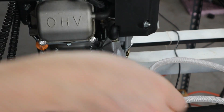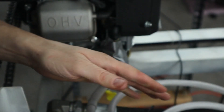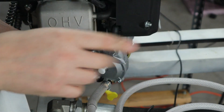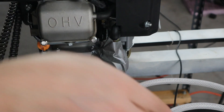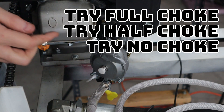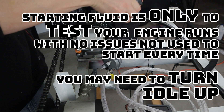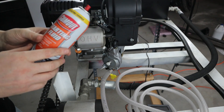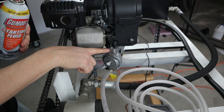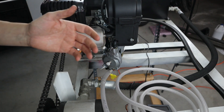In order to start it, I'm going to burp the diaphragm — when you burp the diaphragm, you're letting some propane through, so long as you have your regulator in place properly. To start the engine, push the regulator in and switch it all the way to high, making sure there is no flow — you have to listen and confirm there's zero gas flow at this point. Once you're ready to start, with it on high, burp the regulator for a couple of seconds and give the engine a couple of pulls. If that doesn't work, try a little starting fluid — pop your air filter box, remove the air filter, and spray a small amount into the housing. Once it's running with starter fluid, make sure that screw and control are aligned properly. You should not need starting fluid more than the first time as you're learning this new carburetor.